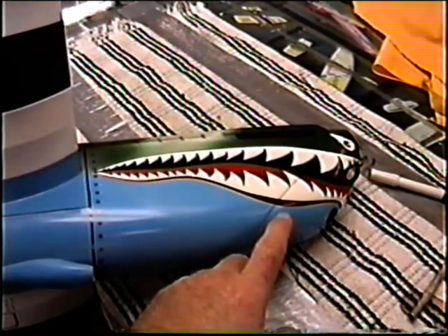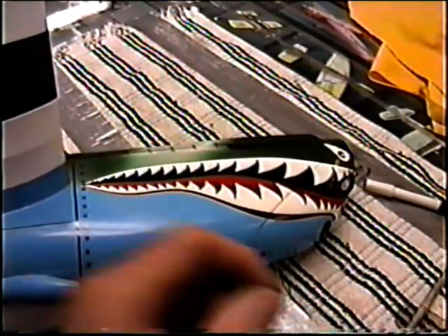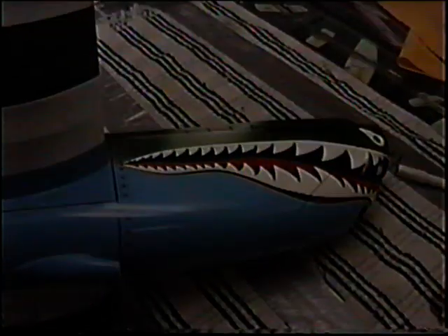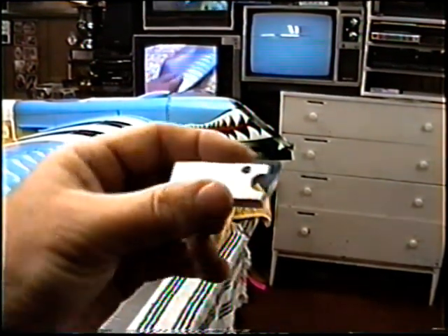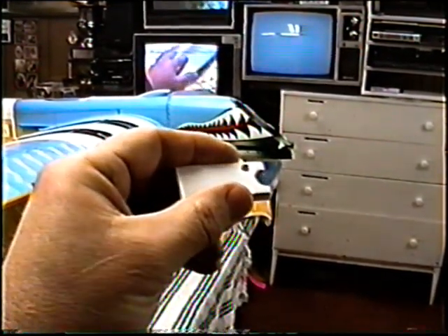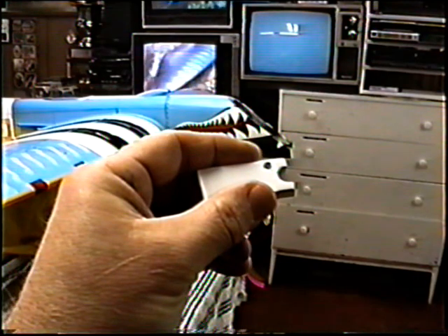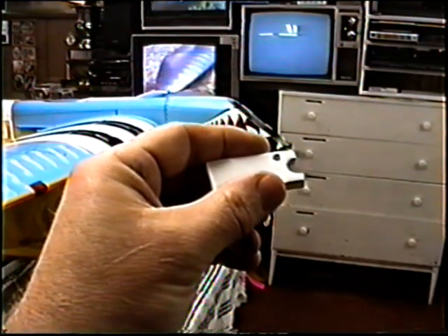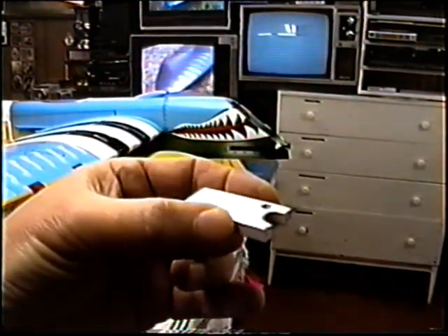What I always do is take all my small parts off the plane — all the pieces I can spray individually — and do a little test with the clear to make sure I don't have any moisture or air that's going to affect the final clear coats. I take one of the small detachable parts, find a way of mounting it, and spray up a 50-50 mixture: 50% Brodak clear, 50% thinner. That's usually a little thick to spray at 25 pounds, so you can go up to 30 pounds or add a little thinner — in this case I'll add just a little, bringing it to about 55% thinner.